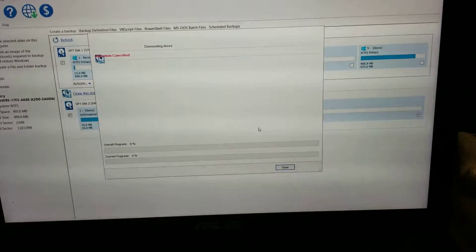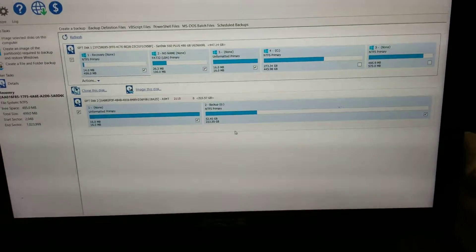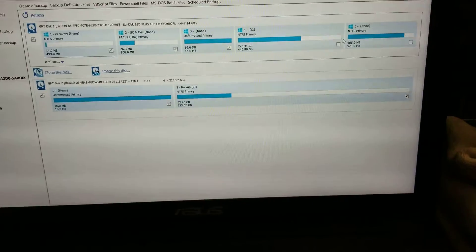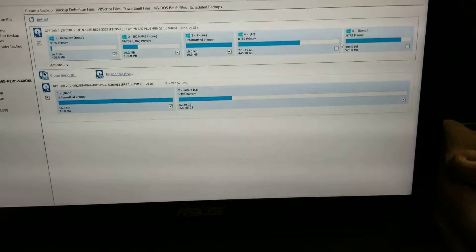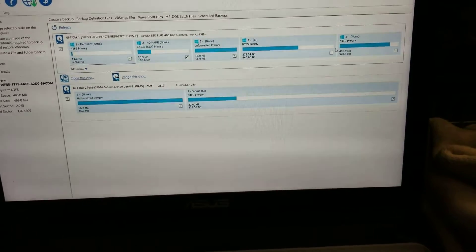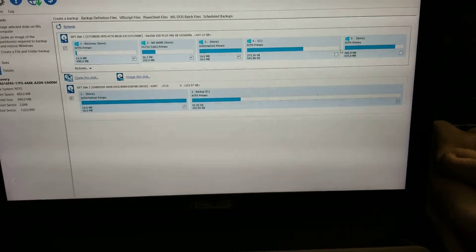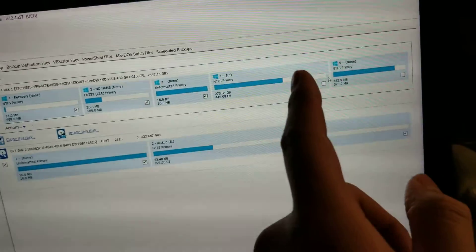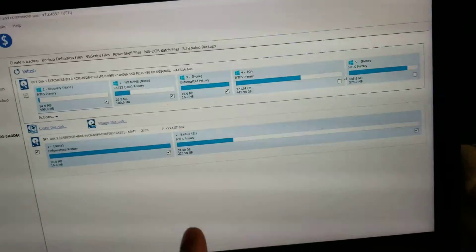If there was data on your new drive, it'll tell you here that all the stuff is going to be overwritten, and you can't even click Continue unless you click the check mark. So you would click the check mark and then say Continue and it'll basically wipe your whole drive. Make sure you select the right one because if you select the wrong drive and click the check mark, it's going to wipe out your drive. After you start it, you'll see the progress — the overall disk clone progress, and the current progress is just the partition it's currently working on. You can close it, then shut down your computer, swap the hard drive out, boot it up, and it'll work.